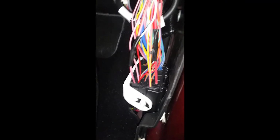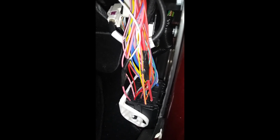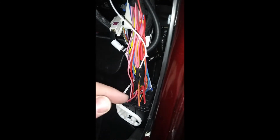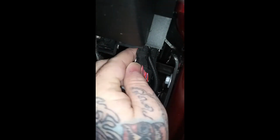Okay, so you see both of them, the wires are in just like before. Just put a hole in there, put the wire through, military spliced it. Gonna get all this bundled back together. I'll tape it up. I'll try to start below this electrical tape so it looks like it's stock until I get all the way up to there. And then it'll look stock coming in there. And then I'll show you what that looks like when I'm done with that.